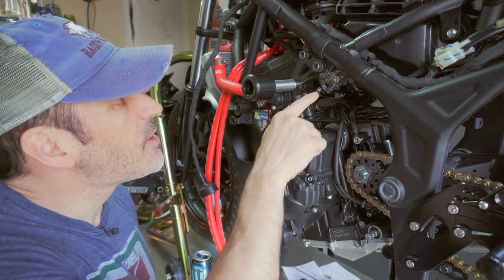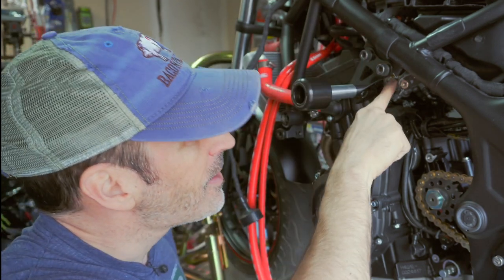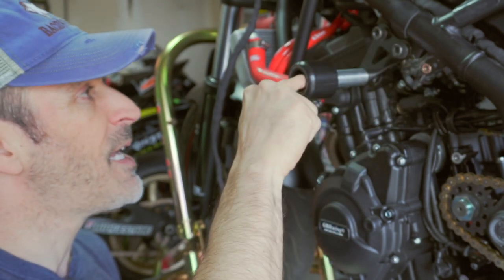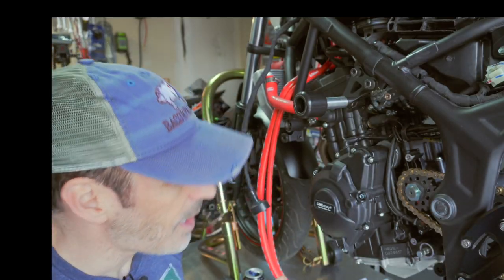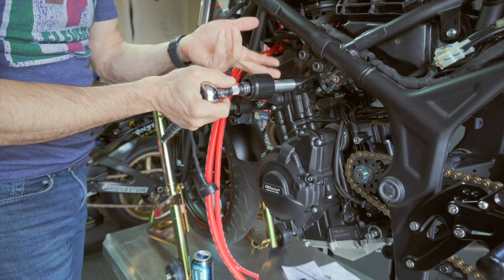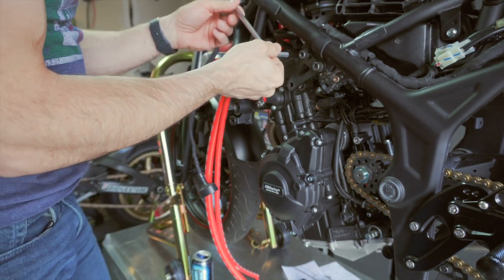The spring is behind this bracket here. I could remove the tank, remove the bracket holding the cables, and try to undo that nut — but I think it's going to be a lot easier to simply remove that triangle piece of metal by removing those two bolts and this one here, and that will give me direct access to that nut and the spring. I'm using a 17mm socket with a ratchet for the frame slider bolts. The size of the bolt might be different for your bike, but after that you remove those two bolts — it's an internal hex which is 8 millimeters.